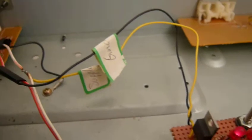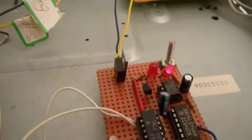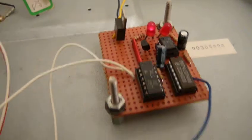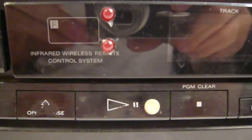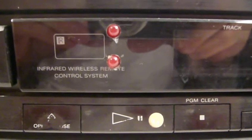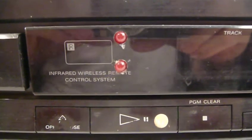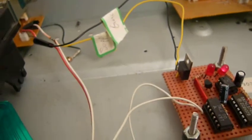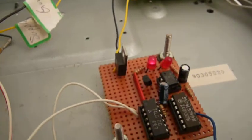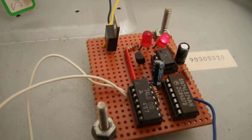Black and yellow wires are spliced into the power supply of the CD player. The blue and white wires are wired to the buttons on the front panel — the white wires lead to the open/close and stop/program clear buttons, and the blue wire runs into the play/pause button. The LEDs on the front panel are not wired in; they're just hanging loose. I imagine if the circuit had been completed, those would have been wired into this board to flash just like the internal LEDs do.